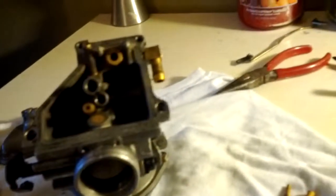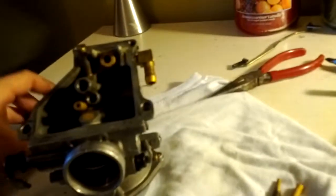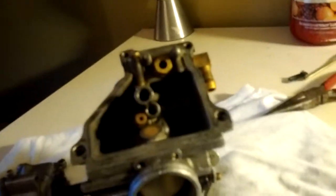That's kind of what I did. I cleaned everything else out with carb spray, and I'm going to reassemble everything and it should be in good shape. The reason why these get all gunked up is people don't clean out their carb bowls and their carbs. Gas stays in the jets and in this little valve and everything, it gets gunked up and old. Then the float valve will stick open or closed and it'll leak, and it won't get enough gas, or these holes will be filled up and it'll run crappy. That's why it's a good idea to clean them out — you just spray everything out with compressed air and visually make sure that everything works fine.